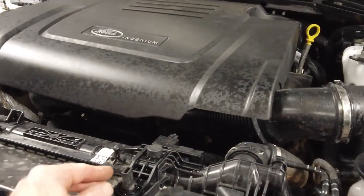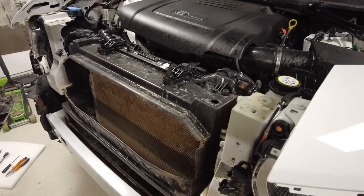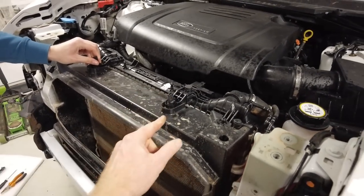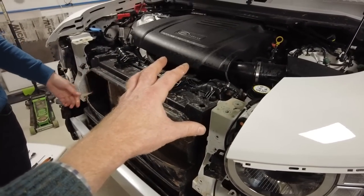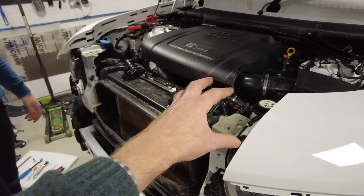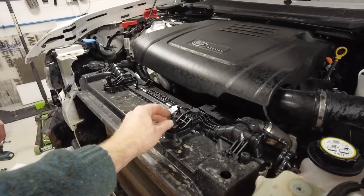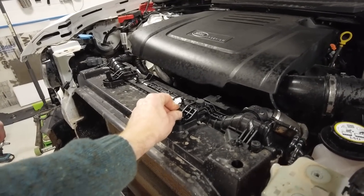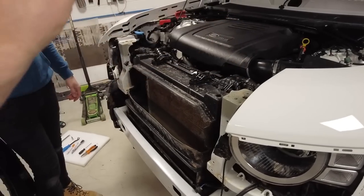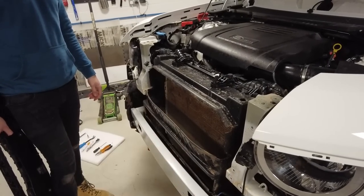Yeah. So what this is, Tyler, is the whole radiator. Look, it's free. So let me zoom out. Give that radiator a wiggle. So yeah, these are on the pins, wiggle the pins. The whole radiator pack is not linked to the engine, because if it was, it would rattle apart. But of course, the cables have to go to the engine, the pipe, sorry. So when they mount radiators in cars, they do it in this sort of semi-flexible way. So it just sort of goes with the flow. It's neither connected to the engine nor the chassis. It just sort of sits on the fence, really. But it seems to work.